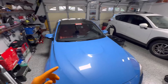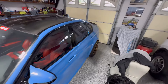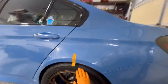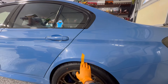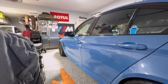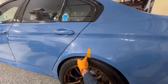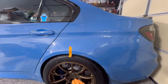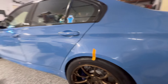The only concern is that those who run these springs know that for the rear, if you take out the rear puck, the car drops way too low and starts to tuck the fender liner, which is something we don't want. With the puck in, there is a gap compared to the front, where it sits at the perfect height. The rear has a little bit more of a gap.